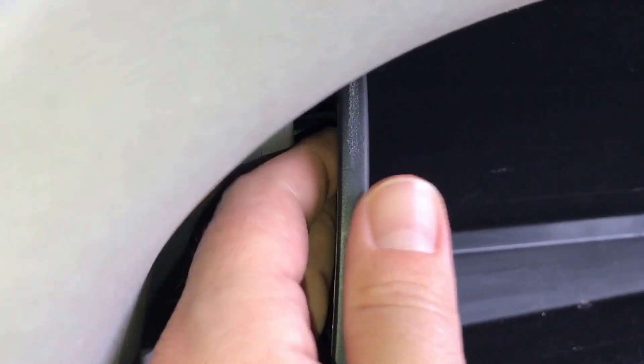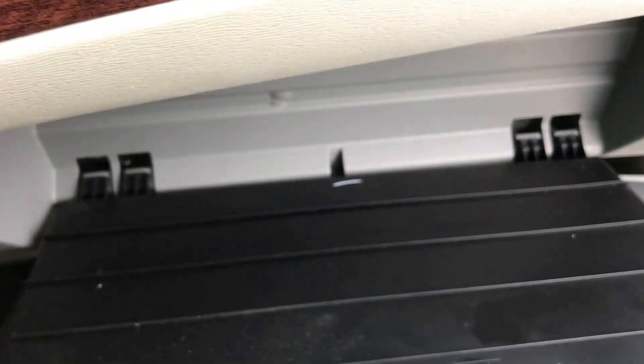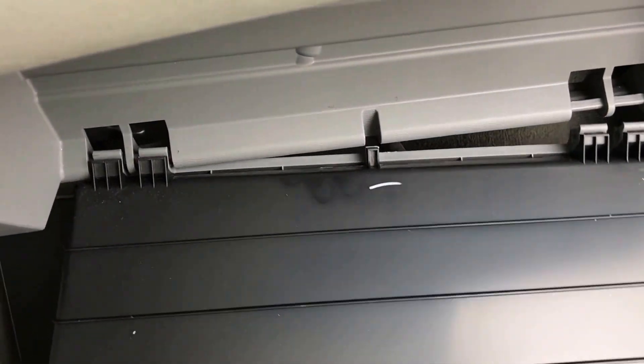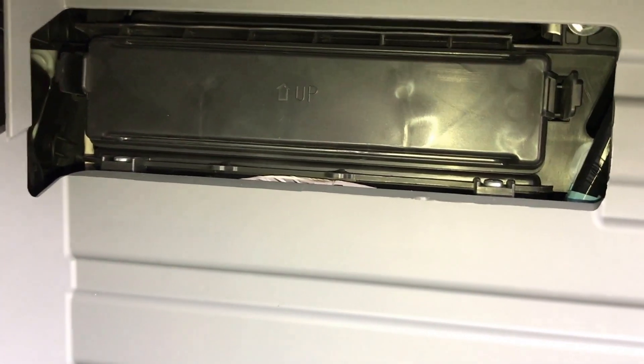There's also an arm in here. Let me turn on the light so you can see that better. Here it is with the light on — you can see we have the same thing on the other side. Just reach your hand in there and now it has come loose. You're just going to gently lower it and it will come off of its hinges — that's okay if it does. Just let it drop down and it will reveal the access panel for the cabin filter.